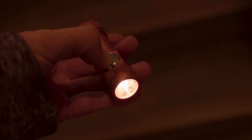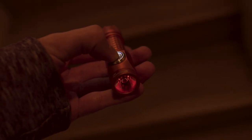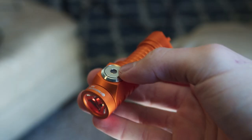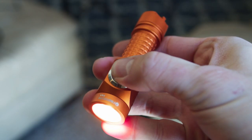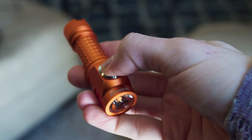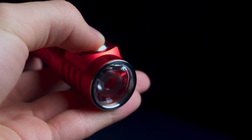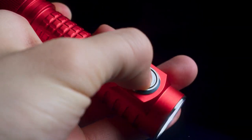It also does not allow for reliably activating moonlight level from off, just whatever level was memorized in the low mode group. The UI also has a four-click lockout that deactivates the auxiliaries and renders it unresponsive. Three presses from off enters the bizarre self-defense mode, which is just a press for strobe instead of constant on. Perhaps that's useful to someone, but it's not appropriate for stressful situations because it requires three presses and then an additional conscientious activation, and it's useless for illumination at that point, until self-defense mode is turned back off.